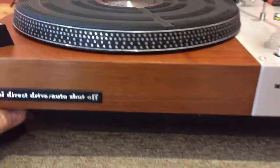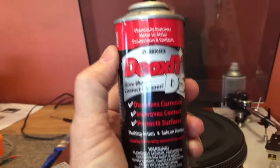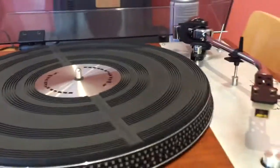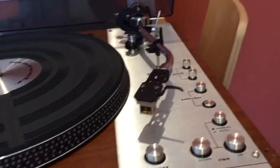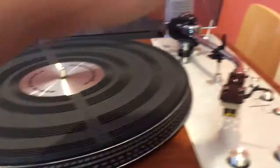Another thing you may need to do — and I had to with this one — is address the speed controls, which become a bit unreliable with age. The best product you can buy for cleaning any kind of potentiometer is Deoxit D5. It's not cheap — the can I'm holding is forty or fifty dollars — but the stuff is really superb; there's nothing better for noisy switches and pots. I also adjusted the master speeds on the motor. Underneath the motor there are two speed controls, which were adjusted to bring the controls back to midrange for correct speed.